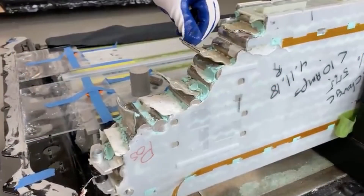On the Model 3, cooling ribbons run between every two rows of cells — that is not going to be necessary anymore here because cooling will come from the bottom of the cell. This also simplifies manufacturing quite a bit.